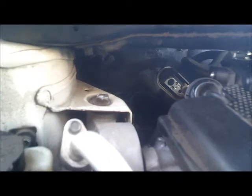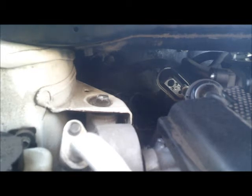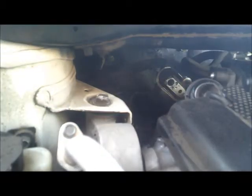Now we have to remove the two bolts that hold down the expansion valve. And another thing that helped is I had to loosen and remove the nut that holds down the line from here so that it will move freely. Okay,